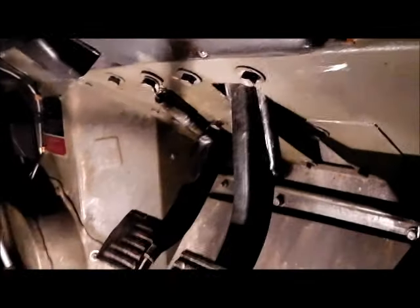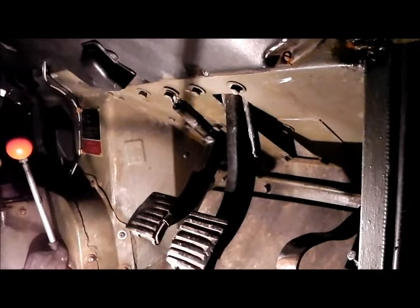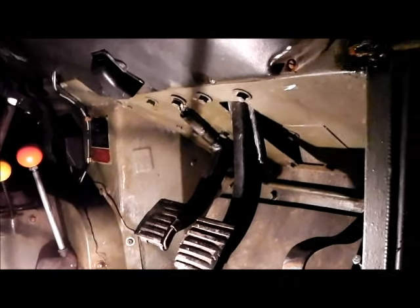Here are the six bolts we'll have to undo - kind of like machine screws - there's a captive nut on the pedal tower for each one, and we need to remove that spring of course. Then you can lift out the pedal box, twist it, and the pedal should come out through the hole in the bulkhead.